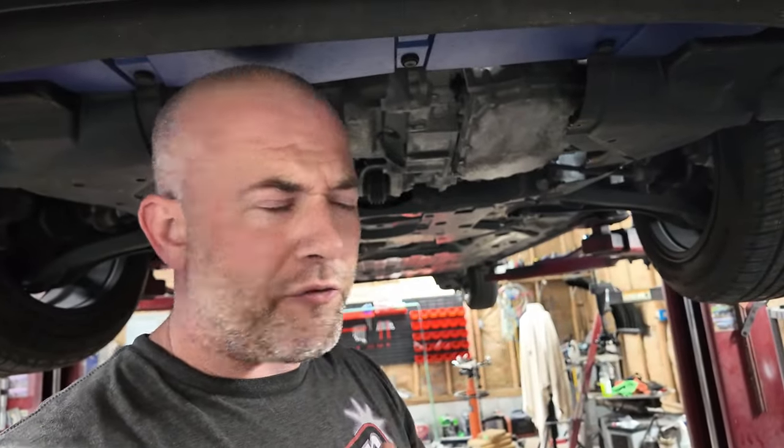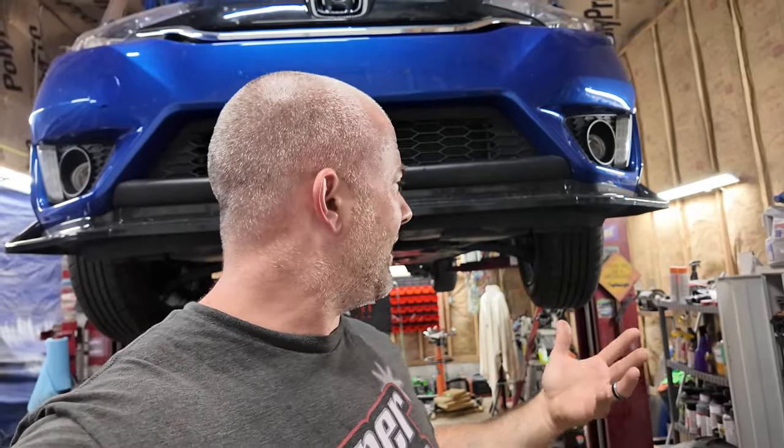But the question for me is, what temperature is the fluid when they're doing this? Because if your fluid's hot, then it expands. So that's not telling me exactly how much fluid I'm supposed to... Whatever. I mean, obviously the fluid's cold because they just put new in.